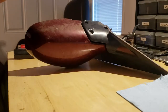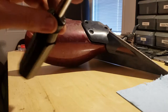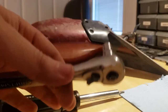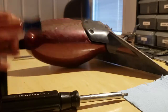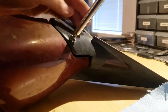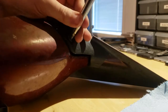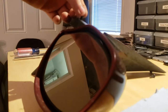For this next part I'm going to show you how to disassemble the mirrors. To do this you're going to need a T20 torx bit in either a bit driver or a ratchet with a quarter inch socket, and you're going to need a flat head screwdriver. Down on the bottom there are three torx bolts — you need to take each of those out.